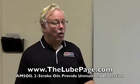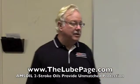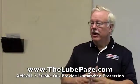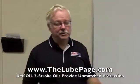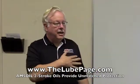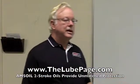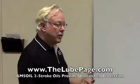They loaded the oil that was the two-stroke oil up with gobs of zinc and phosphorus, hoping that if the zinc and phosphorus got on the walls of the moving parts, it would at least protect it from scuffing, from metal-to-metal contact. So that was the deal. Throw it in there and hope for the best, okay? And so early on, two-stroke engines sometimes had a tendency to wear out prematurely because they weren't very well protected.